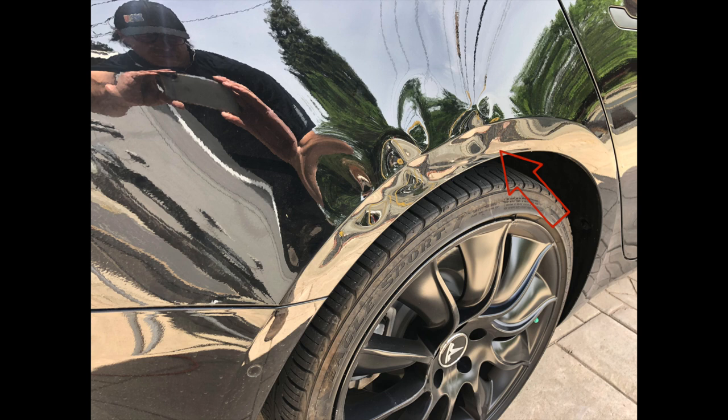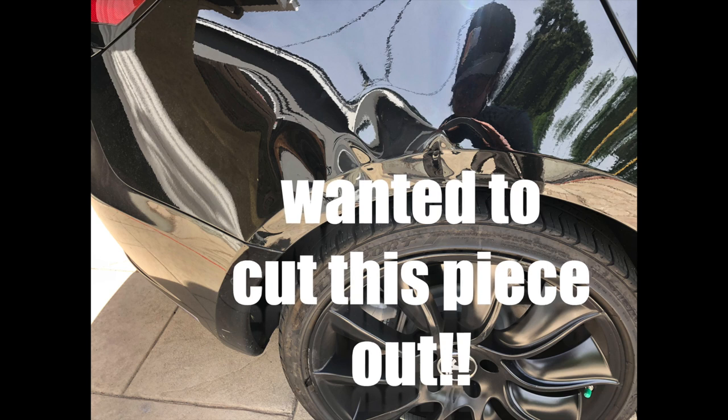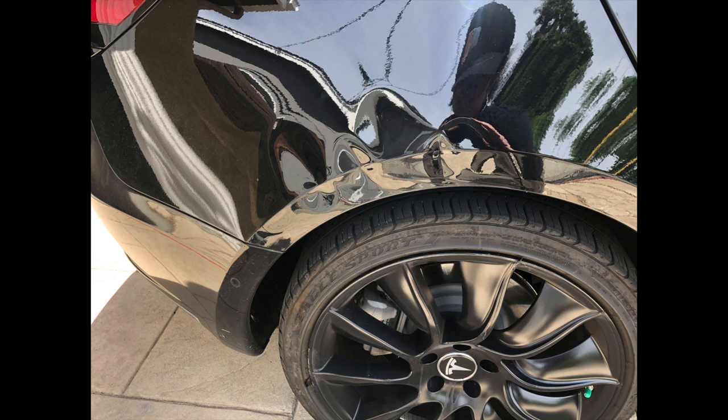A lot of the times when you're working in those areas, you don't get a second chance. You make one good pass of a particular trick you're going to use — and if it works, there you go. If I raise that curl enough, I'll have a chance at this part. This is the beginning of the seam; that line right there is protruding outward and I have to tap that back down. These are the areas where I prep the customer that it may not be perfect — may have a few flaws or wiggles in the reflection. This customer was fine with that, because the alternative is replacement. It was a $5,000 quote from the body shop to cut this piece out and replace it and repaint the entire rear quadrant. Repainting is not a good option — you lose all the factory-applied paint and hardened clear coat, which is amazing.